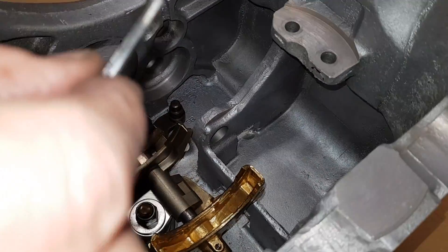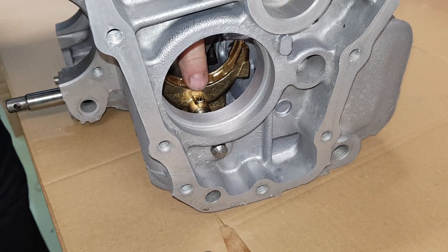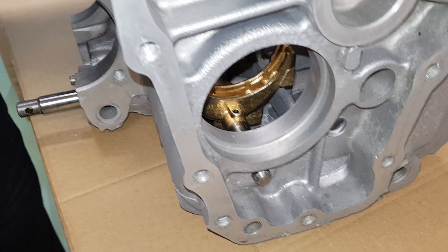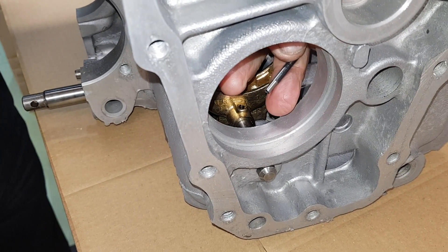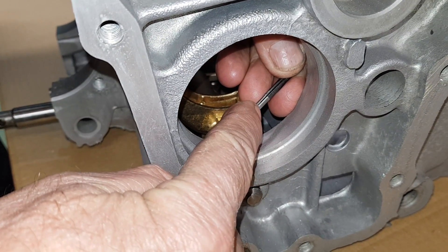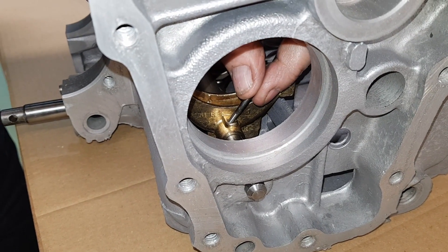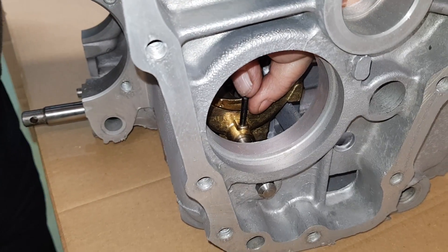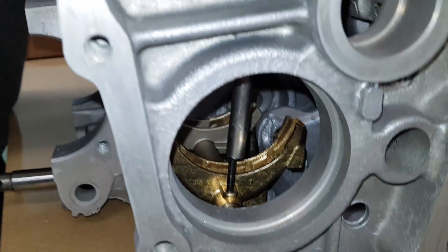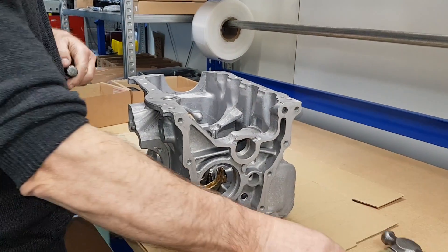You've now got to put this little pin in the hole through the selector fork into the shaft. Here's the hole that goes through the selector fork and through the shaft. This pin has got a pre-machined diameter on the bottom so it fits nice and easy to start. Pop it in the hole and then get a punch and knock it into place. There we go — that's firm.